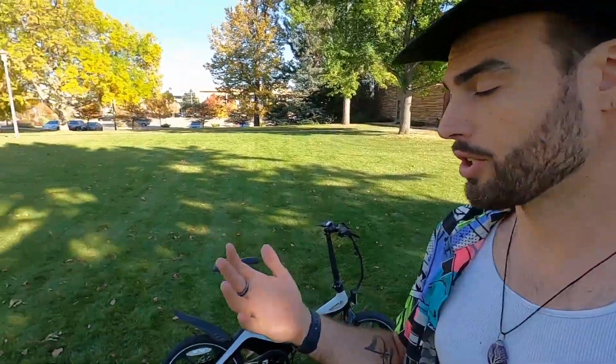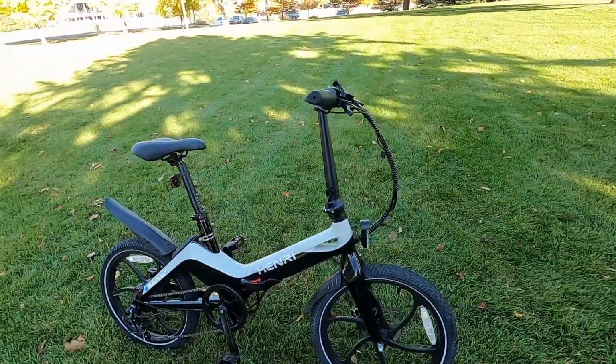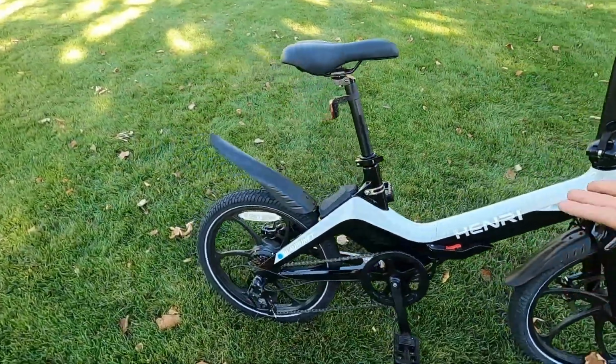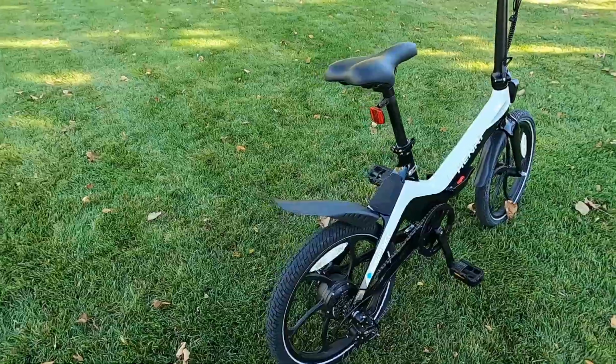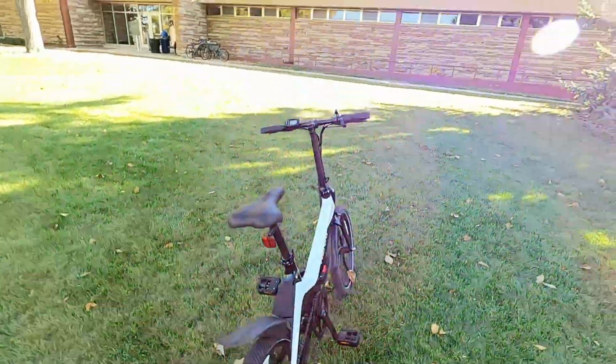And it's also softer. It's not as rigid, so it's vibration damping, which helps to make this a more comfortable ride. But on the flip side, magnesium is a lot more expensive and difficult to manufacture, and so that means it costs more. And another downside is that it is prone to corrosion. This is a beautiful frame, and it's painted well. It's got protective paint on it that will prevent corrosion, but if you get scratches or chips, or live in an area where there's just a lot of natural corrosive stuff on the roads, maybe you live by the coast where there's a lot of salt, or even in mountain towns in the winter, if they're putting de-icer and salt on the roads all the time, it's gonna mess your bike up.